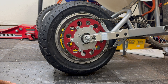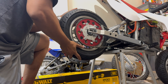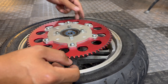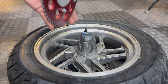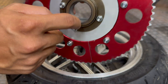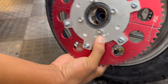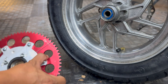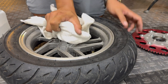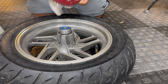I probably should have put the bike on a stand. Here's a closer look at what the problem is — you can see the threads are completely stripped out on the wheel. What I'm hoping to do is screw the freewheel in as much as possible, as flat as possible, and then have my buddy tack weld it on the outside and weld on the inside. I'll clean and prep it as much as I can and then let him take over.